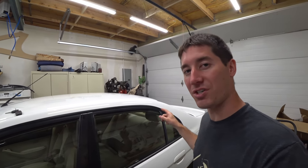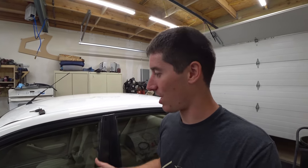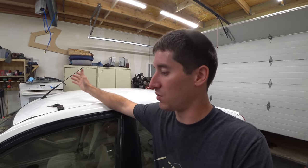We did what the forums recommended — replace the 31-pin connector A on the motor controller, which is the biggest connector on there. If you just unplug it there's no more IMA, and the motor itself turns into an alternator. It uses the DC-to-DC converter and charges the 12-volt battery, so suddenly you have a drivable car. I left the breaker off on the battery, unplugged the connector, started the car — suddenly it has power. Electric power steering works, it drives right. Most of these parts are gone and only come from salvage yards at this point, so maybe we'll just sell the car as a project.